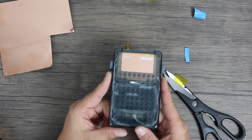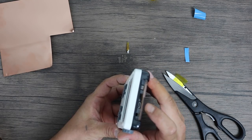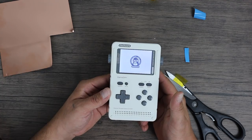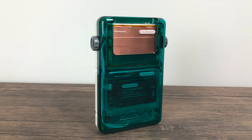The moment of truth — we're going to go ahead and boot this thing up. I think it looks pretty cool in the back. We can get power and you'll still see the LED from the very top. It works — I didn't short anything out! One of the main issues was when transferring large files over my network to the GameShell with the governor set to performance, it would shut down every once in a while. I just transferred about six PS1 games over my network and it didn't shut down at all. You can still feel heat coming off the copper and that's exactly what we want — the copper soaking up as much heat from the CPU and RAM as possible. Hit that like button, subscribe to the channel, turn on notifications, and as always, thanks for watching.